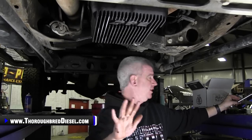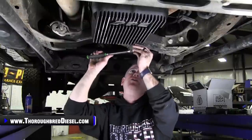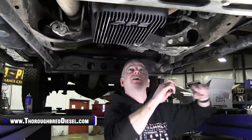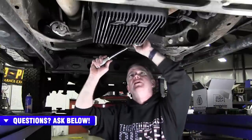With your bolts torqued down and everything checked, here's something a lot of people don't do — before you start filling with fluid, make sure the drain plug on the new pan is tight. Also don't forget to check the temperature port plugs: the one eighth and quarter inch plugs — make sure they're tight. Nothing's worse than starting to fill with expensive new transmission fluid only to have it run out because one of those was loose. Once everything's checked, head topside to fill up.